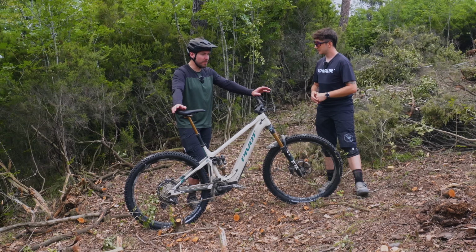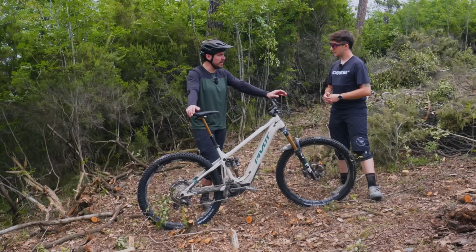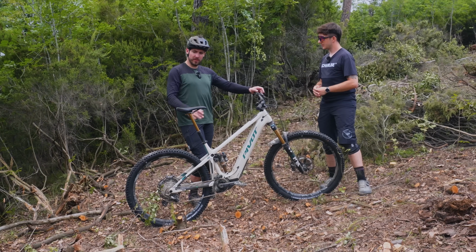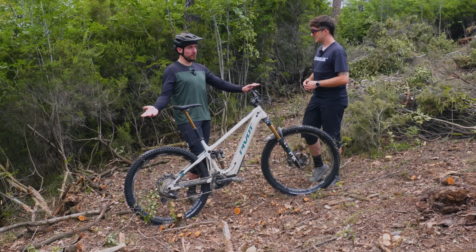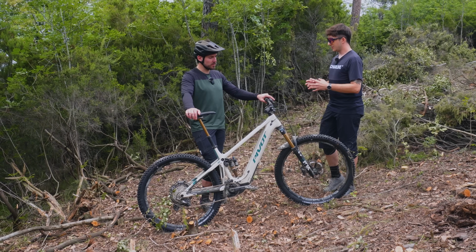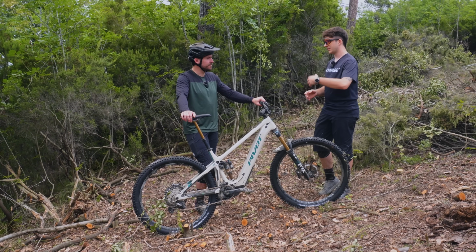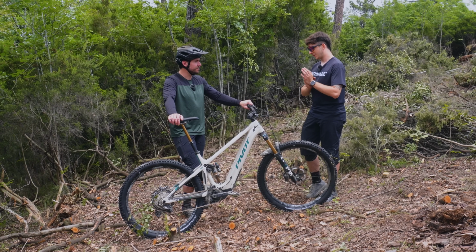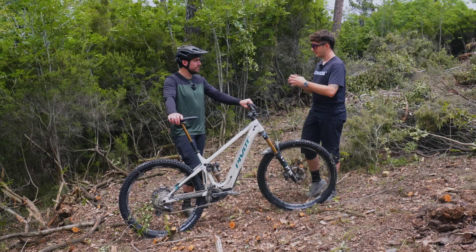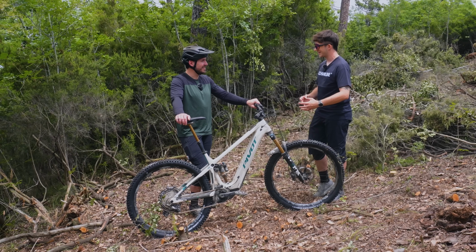And that's primarily smoother terrain that you're going to feel that? Yeah. 'Cause I guess with a more supple carcass, it maybe could roll even faster through rough terrain? Exactly, yeah. This is all measured on our rolling resistance tester, which is super smooth. I also have to say that this is a drawback that would only be true for traditional tread patterns, but today we've also tested a new tread pattern.